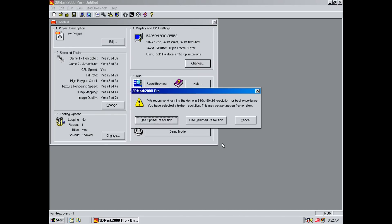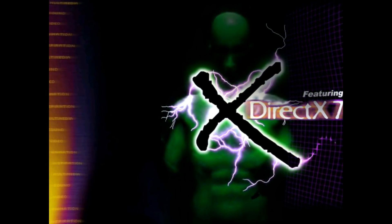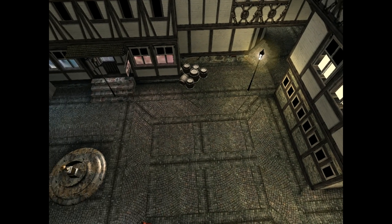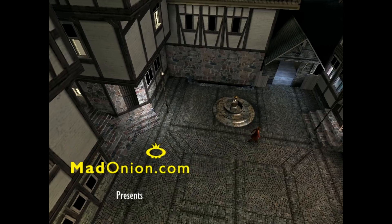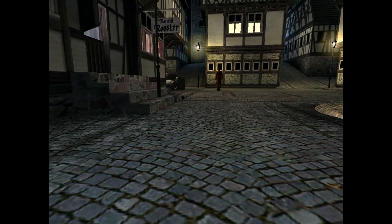I put it in our test machine, an Athlon 64, and installed the latest Radeon drivers. Everything is fine — we're running some 3DMark demos at 1024x768 with V-sync enabled and 16x anisotropic filtering, and the card works just fine. I returned it to the owner, he's happy, I'm happy — maybe this video makes you happy too, to give your retro or not-so-retro computer parts a good clean.